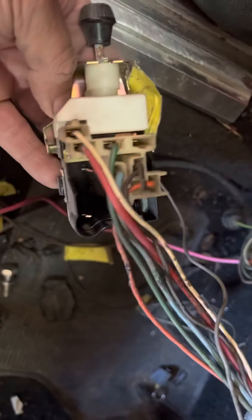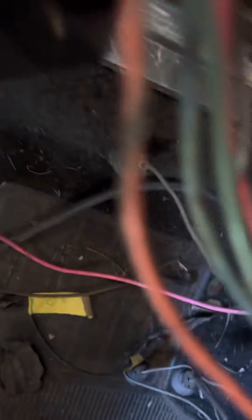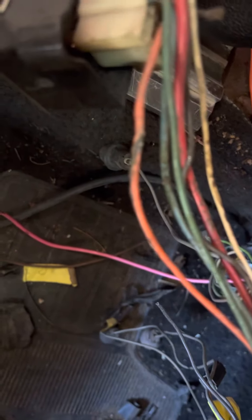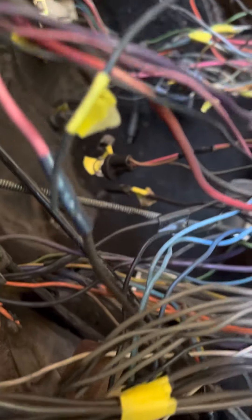As you think it's easy, you're gonna get into something like this headlight switch and be like 'holy cow, what goes where?' You can actually see on this headlight switch some burns and crackles and really crazy looking stuff — people cut the wires. This is why we're going through this and getting rid of the majority of the old wiring. Same thing with the ignition — there's a big wire going to a smaller wire, and you've got to deal with all this when you put the new wiring in.